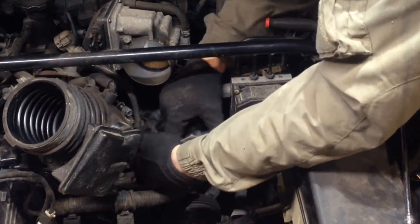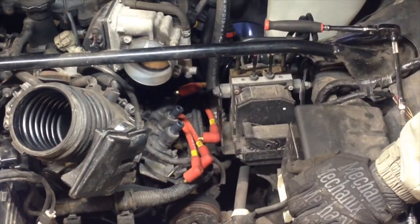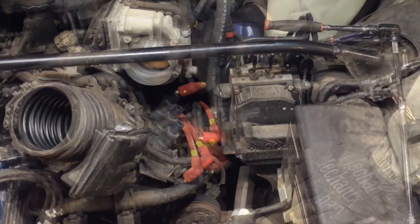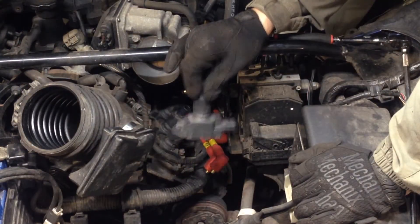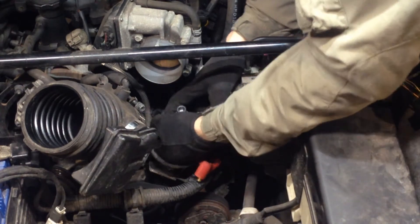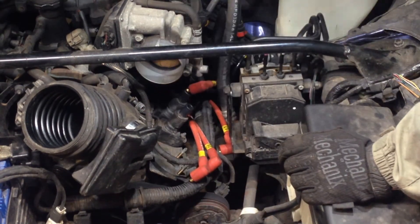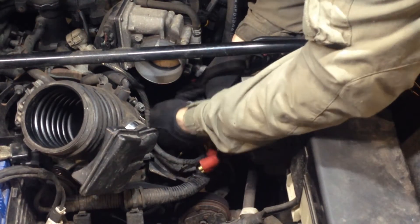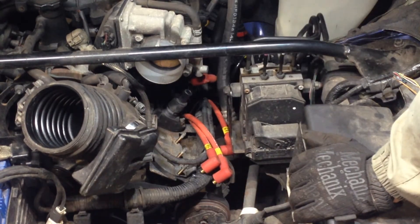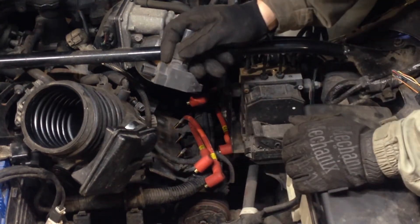Come up like so, nut in there, then remove the coil pack. Repeat that process three more times to take all the rest of the coil packs off. That's front rotor leading coil removed. Now onto front trailing, rear leading, and rear trailing.